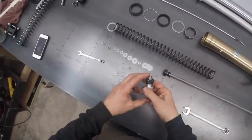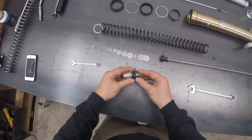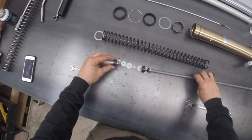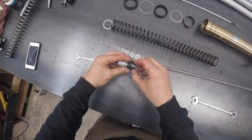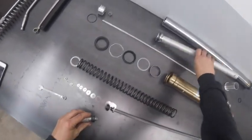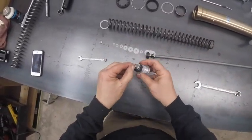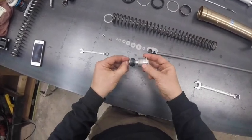On the other end, you have the compression valve, which works pretty much the opposite way. As the damping rod is coming down and squeezing the oil in the bottom of the cartridge, it is closing this valve, forcing the oil to squeeze out past these shims and then out the holes of the cartridge. So to adjust the same deal here, if you want to adjust your shim stack, you're going to grind this off and take this nut off.